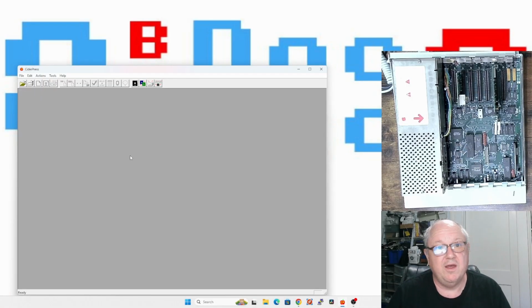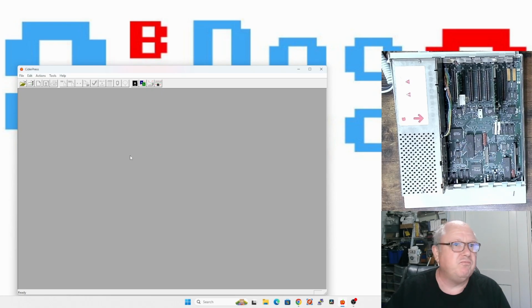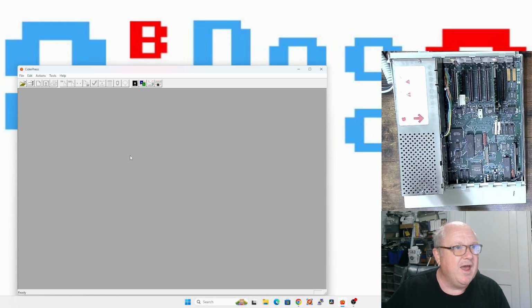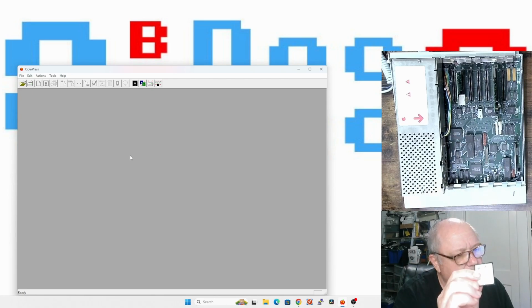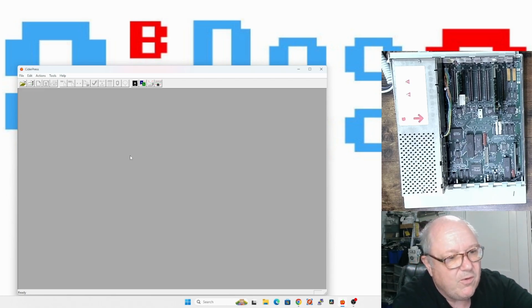Okay, so what we're going to do now is the software installation part for the GS. I actually want to try to do a full install on this so we can go through all the things you would do to install GSOS, enable AppleTalk networking, and set it up to print and everything else. And the tools we're going to use, rather than sitting here and sticking a whole bunch of floppies into the drives and booting that way, is we're going to just remove our CF card, which is in a microdrive turbo. This is a 256 meg card that has 4 32 meg partitions on it. And we're going to stick it into our Windows card reader.